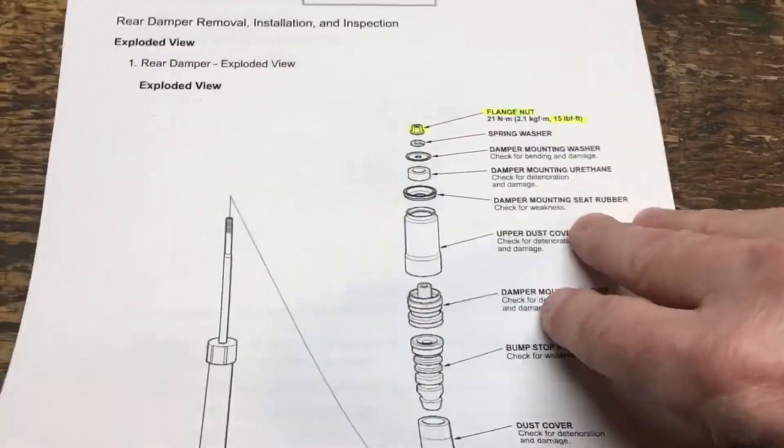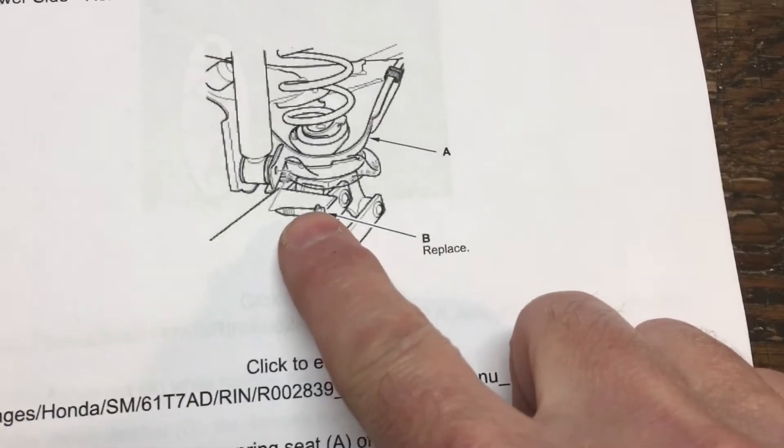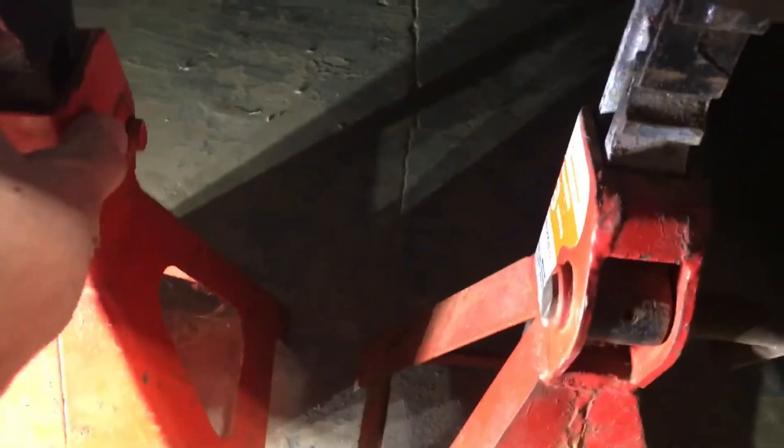It's a nut on the top and a bolt on the bottom — the strut will come out. Pretty simple. Car's chalked there guys, under the axle stands. This is not doing anything — this is just here as a safety. It's not under any load, as you can see.